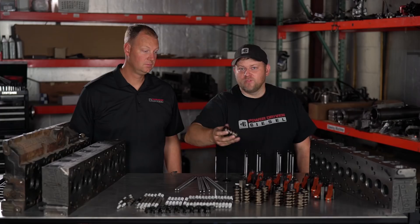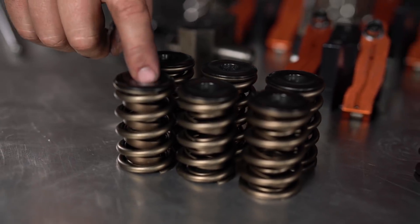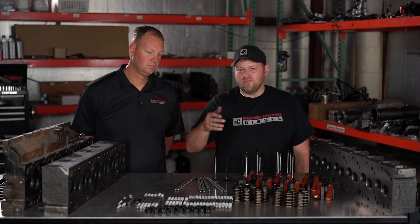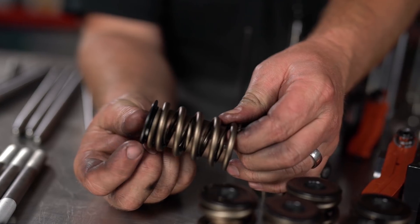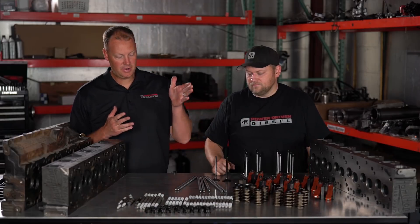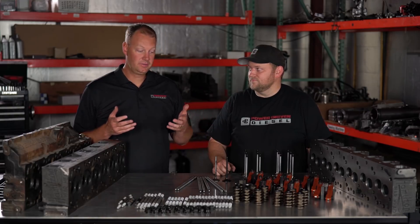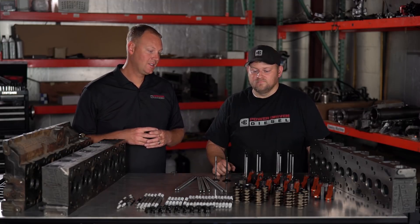One other advantage of using an 11/32nds valve is it unlocks the world of gasoline-performance valvetrain valve springs. We can use these nice dual valve springs with an isolator — some people call them a triple, but technically they're a dual valve spring. The Warhead has a bigger valve spring pocket, so these will drop right in. A lot of these are at a budget price — maybe even cheaper than or about the same as diesel springs. Because this has been around so long, there's such a huge aftermarket for the gasoline world. You can get a spring as good or better than anything in the diesel world for about the same price, maybe even a little less.